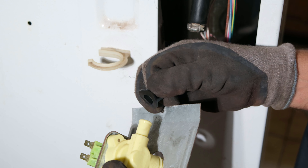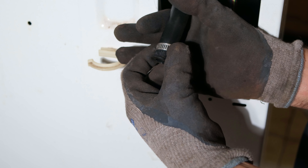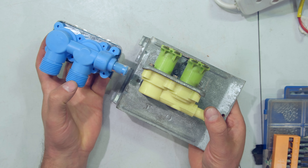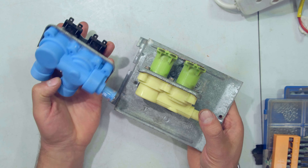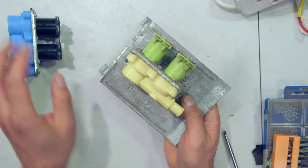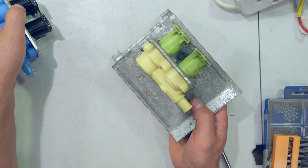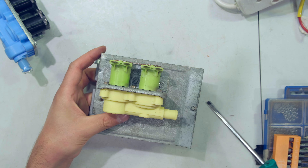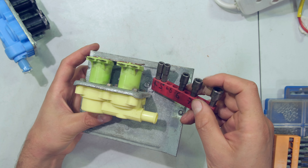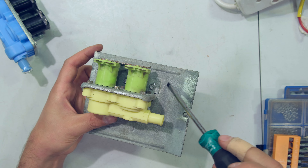I'm removing the old solenoid. Keep this insert - it's useful. I'm putting it back inside the pipe because it stops the pipe from deforming. Here is the old unit and here's the replacement - I'm replacing it with a generic so it's not exactly the same, which means there might be some trouble lining up the screw holes. I'll remove the old one and use the same plate to install the new replacement unit. The fastening screws have a hex head, size 6.5, which is uncommon, so I'm just going to use a flat screwdriver.